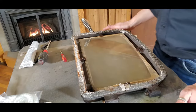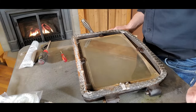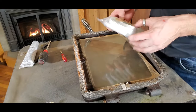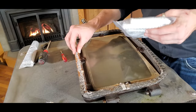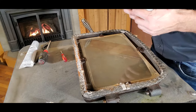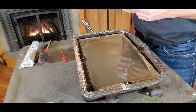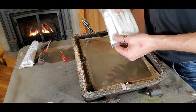As we set up our work area, you can lay down drop cloths — we may make a little bit of a mess, so it's important to be prepared for easy cleanup. Now for tools: I have our replacement gasket kit here. Depending on the make, model, manufacturer, and year, there are a lot of variances in the diameter and length of the rope gasket needed. We offer just about every gasket size, and many are packaged up in nice little kits with a small tube of high temperature sealant.